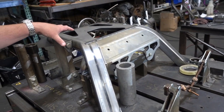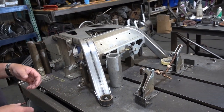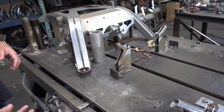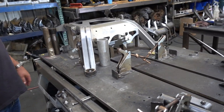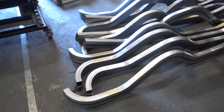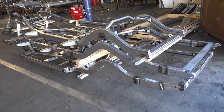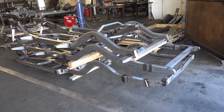This cradle here has two points on either side that line up and bolt into the chassis. What's great about it is that guys can go ahead and install it in unibody cars, put it into existing aftermarket frames, and customers can retrofit it into existing Art Morrison frames. One is a 53 to 62 Corvette chassis, the middle chassis is a 57 Chevy, and the bottom frame is one of their A-body platforms.